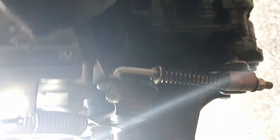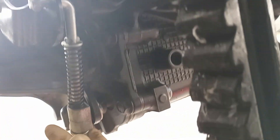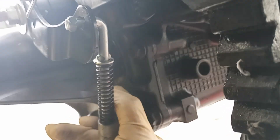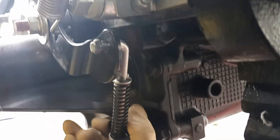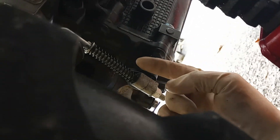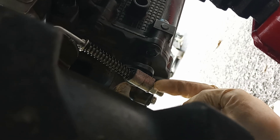So you've got to come over here to the brake linkage. And you can see the brake linkage right there is putting pressure on. The only way you get rid of that is you need to adjust your brake linkage tighter, which will push it up. So you tighten this screw, which will push it up, which will allow your diff to fully unlock. It's a very small adjustment, but that's what you want to do.